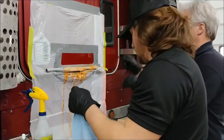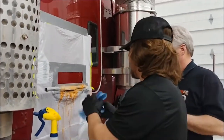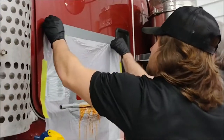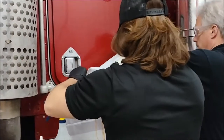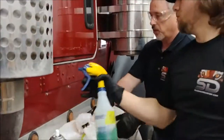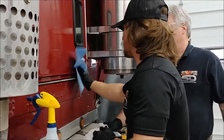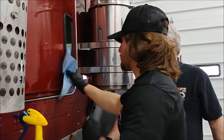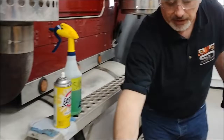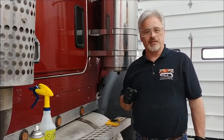We're going to leave the bottom where it's at and bring everything down. We neutralize — and that also neutralizes the adhesive on the duct tape. Now we can come up here and remove the tape, coming straight down. We still have some underneath, so we're going to wipe very quickly, get that neutralized, and wipe back. Take this into the trash, quickly dispose of it, and there you have it — we have removed hand-painted lettering off of the truck door. Thanks for watching.